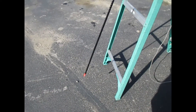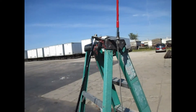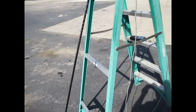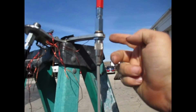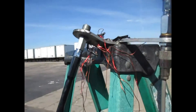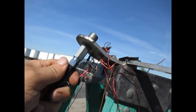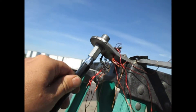You can actually create an artificial ground plane. It's great for testing antennas, and it's nothing more than an antenna attached to the ground aimed downward. You can see you've got the regular mirror mount there with a nylon washer on it. What you're doing is putting another stud mount assembly with no nylon washer, so this antenna actually has a dead short to ground — but that creates an artificial ground plane.